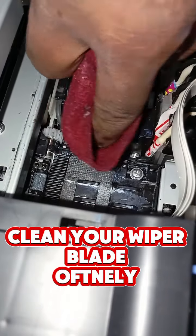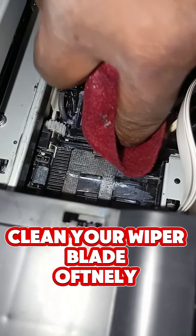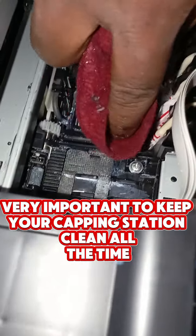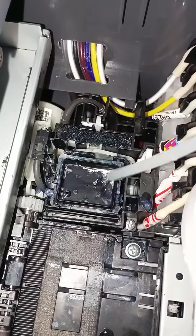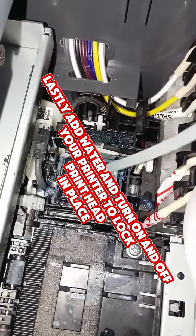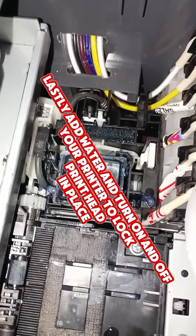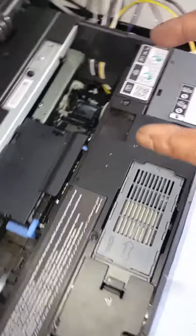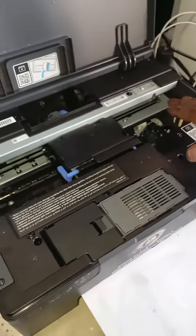Now, there is a wiper blade that I have to clean as well. It's very important — this place here is the lifeline of your printhead. And then you must leave some water in there like that. Then you turn your printer on and off and then it stays like that. Especially if you're going to go on weekends, this is all you need to do — just leave it in water like that. That's it.